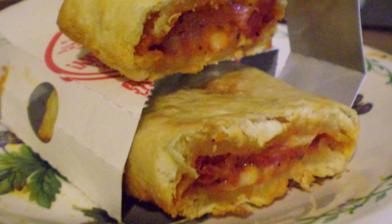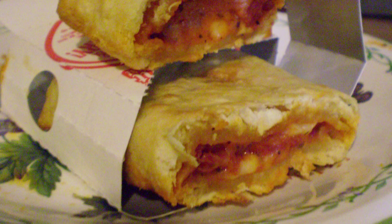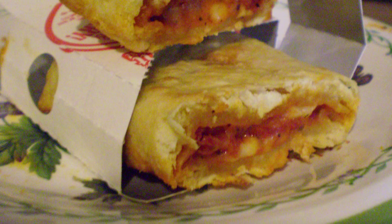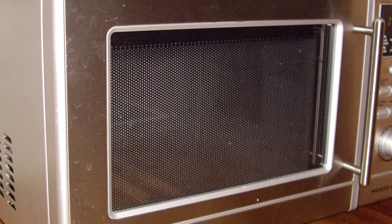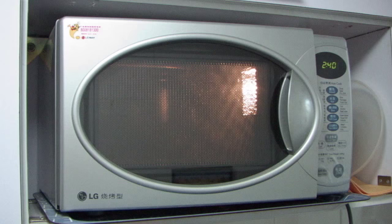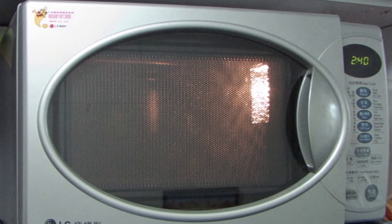The pouch has a thin layer of aluminum lining the inside that is designed to absorb the microwaves and heat up a bit so as to brown the outside of the hot pocket. On top of that, the inside walls of your microwave are often made of metal. If you look closely, you'll also see that the window you look at the food through has metal mesh lining it. The holes in this mesh are smaller than the wavelengths of the electromagnetic radiation your microwave is producing, making it so the waves can't pass through the holes. Visible light, however, is comprised of much smaller wavelengths, so that form of radiated energy passes through the holes just fine, allowing you to see inside your microwave while it's running without getting cooked yourself.